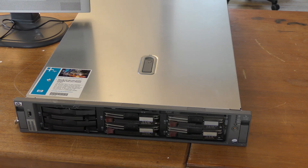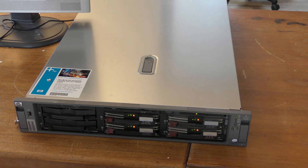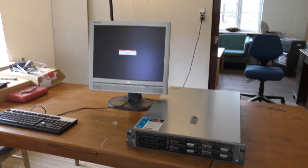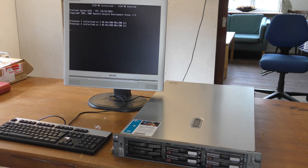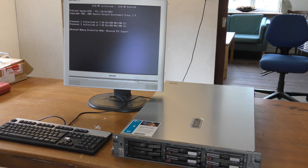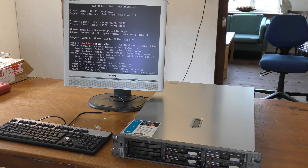I've just powered the server on. If I'm quiet for a moment, you can hear it humming. It's actually noisier when turned off than a regular computer, so the fans and power supplies are definitely running even when the server is off. Turning it on now — HP ProLiant logo appears and it counts up the memory. I'm waiting for the BIOS prompt: it shows the two CPUs, the iLO adapter, the RAID controller, and initializing drives.